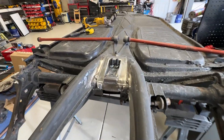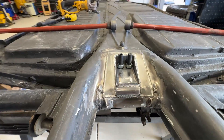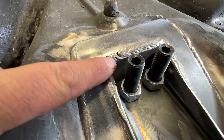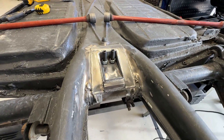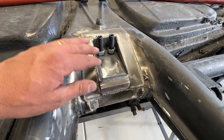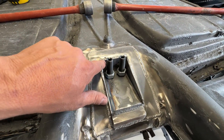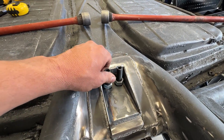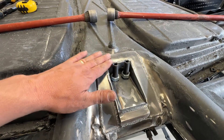This is what it kind of looks like on the bottom side when it's done. I still have a little bit of welding to do on this side — I'll do it when I flip the chassis over. This will all be on the bottom, so even errors like this where I forgot to turn on the gas won't be visible from the top. Once I shoot some spray paint on it, I'll look like a pro. The big lesson I learned — this will be my second one — is I want to minimize the depth right here as much as I can, just so that once I run the screws all the way in, they would just clear a rock.